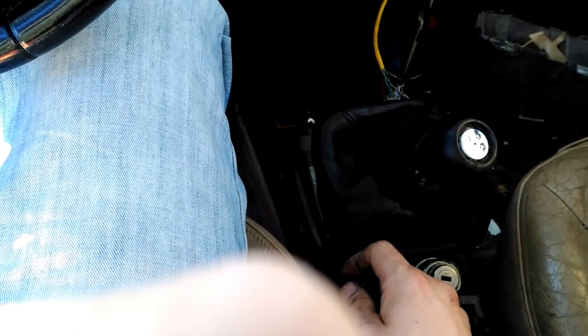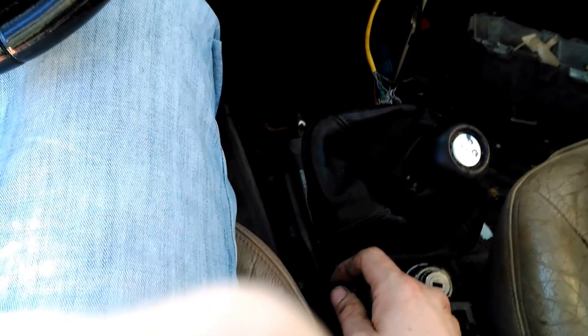What happened was Abby was driving — I won't say anything more about that — and she had gone to park in the driveway and pulled the e-brake up. The e-brake doesn't work real well; we need new e-brake shoes because on the Saab 9-3, the rear rotors have almost like a drum inside them and the e-brake works as a sort of mini drum brake inside the rotor. So she was rolling backwards — she said the clutch was out but I think she had the clutch in — and something happened in the linkage. We heard a clunk in the shifter body.